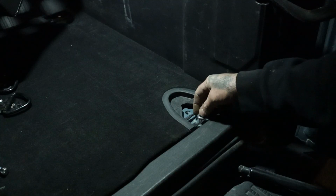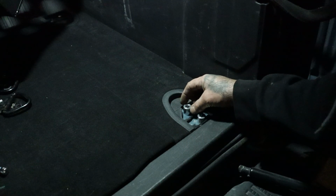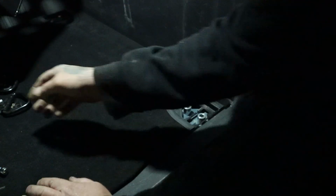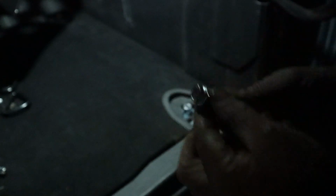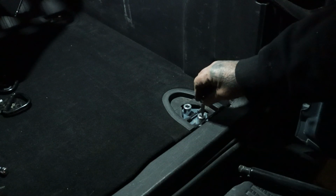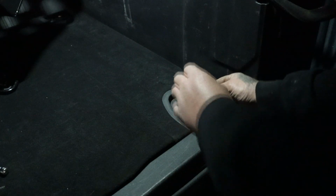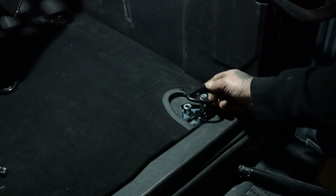So the next step is take these spacers and you set them in here to where they're right above those holes, and you do all 8 of those, and then you can set these side panels down on that, and then take these longer hex bolts and you bolt through the side panel and down through here. But don't forget, you can also put your hook on top of there and bolt through all of it.